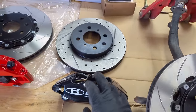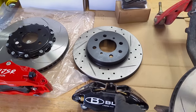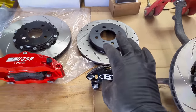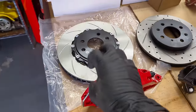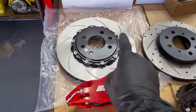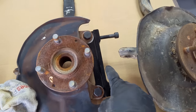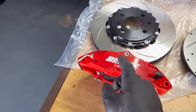The Blox kit fits all the 90 to 2000 Civic EX and SI knuckles, and also the 90 to 01 Integra. So it's the larger 10.2-inch diameter. His kit is actually for the smaller spindles — this is an 11.2-inch rotor. It requires a caliper bracket to mount onto your knuckle, and then you can bolt up the caliper.